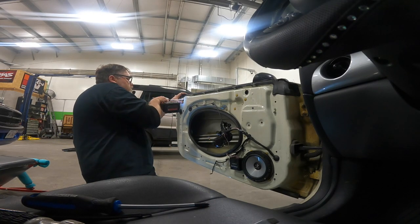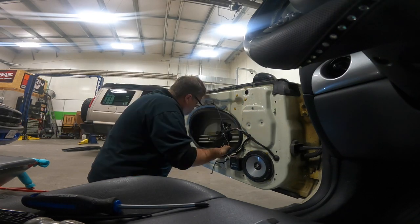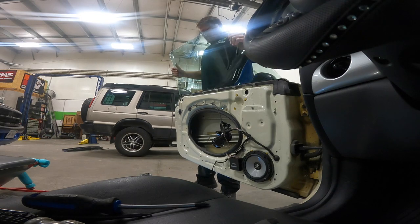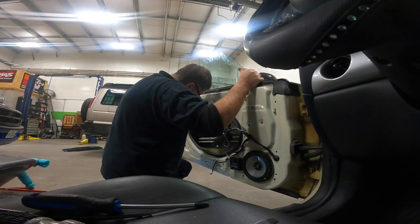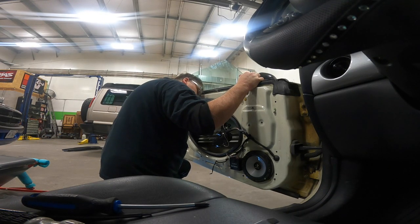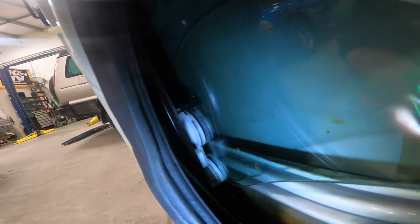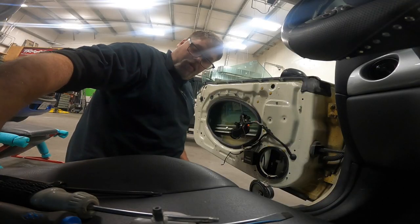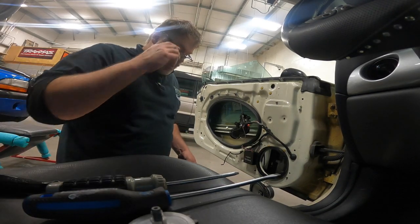All right, there we go — so that's on. Tighten that one. Tighten that one. Leave the bottoms loose. So now we'll get the door glass and slide it in. Slide her down — on the bottom of the regulator there's one that it slides into and one that it sits on top of. The door glass goes into that groove right there. So now what we have to do is roll it up because we have to put something in that. Before we go up with the door glass we'll start the rest of the screws in the motor area.